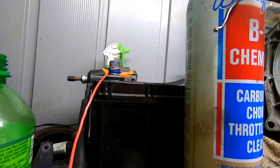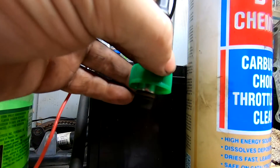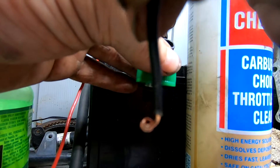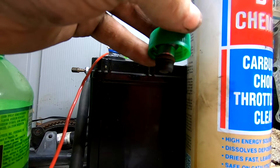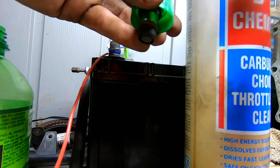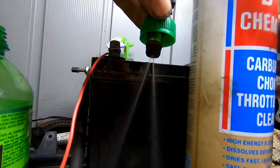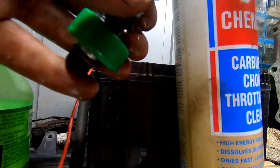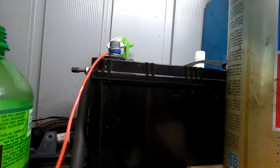I'm going to adjust something real quick. This is another injector. Since I don't have any alligator clips, I just wrapped the wire around something small with a little hole so I can stick it right on there — great connection. I can sit there and it does work. I can see the four holes — so that is another good one here. We'll pull all this stuff off.